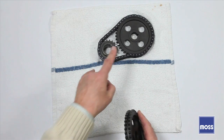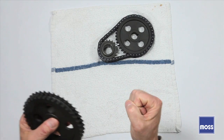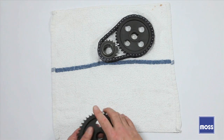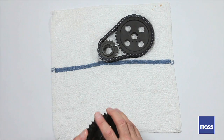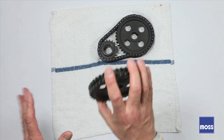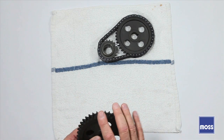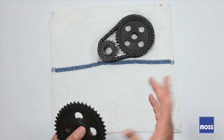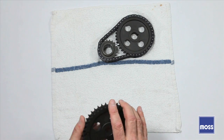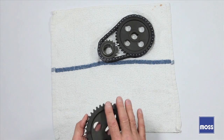If neither your new gears nor your old gears have timing marks, some people will tell you to rotate your engine to number one TDC, then mark the old gears with a punch — for example, where the two points are closest together — then remove those gears, make those marks on your new gears, and put your new gears on in exactly the same spot. That's a little tricky, and so long as you don't move the crankshaft or the camshaft, it will probably work. However, this technician is not comfortable with this because it's just too dangerous if you do it wrong. So I'd recommend that you follow the steps outlined in our next video.